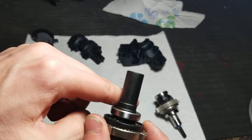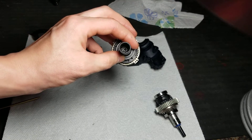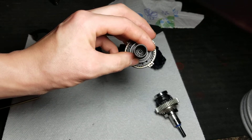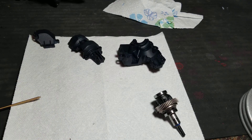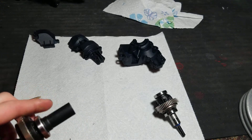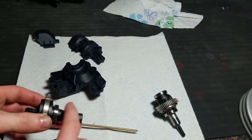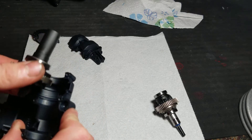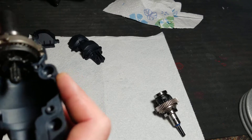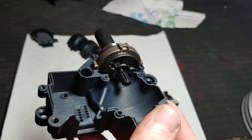If you look in there, there's a little allen deep down in there — that's a 2.5-millimeter allen screw screwed down in there. You do not have access to unscrew this when it's assembled in the vehicle. Now notice this little groove here in the planetary — these little notches. You want to make sure you get the planetary gear set seated in those notches. You take it with the shaft facing out and stick it down in there — it should fit nice and kind of pop in. Then it spins and you get your gear reduction.